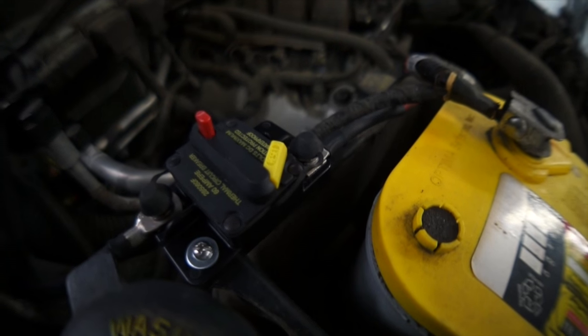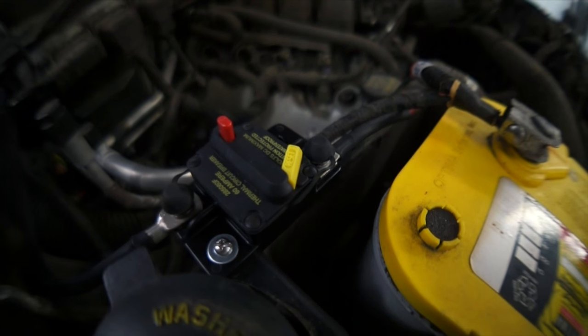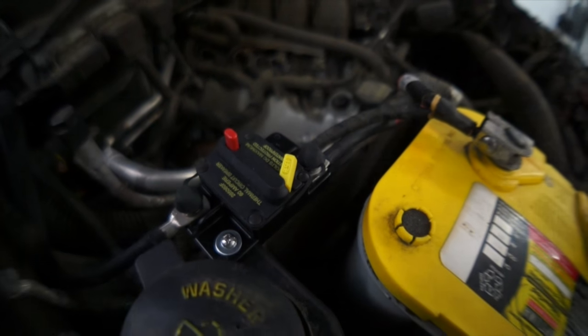All my lugs are soldered and pull tested — they all survived. My vehicle is protected with this 60 amp circuit breaker right next to my yellow top Optima battery. I'm taking my time, making sure everything's perfect before I install my plate, because this time it's going to work.